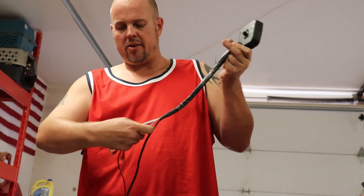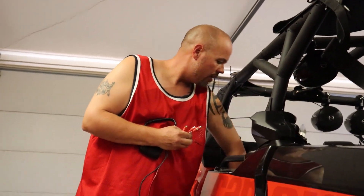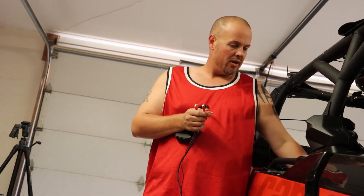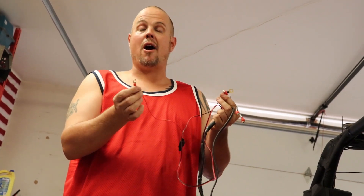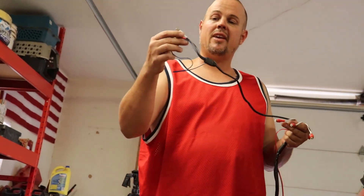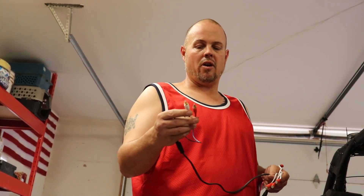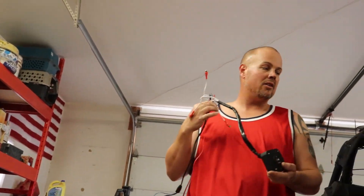You have four red wires that go to each one of your speaker wires — the red one plugs into the speaker like that. The yellow ones go to the harness that powers the LED lights on the speaker. Then there's the main cable that goes to your battery: ground into accessory power port on the block in the center console, and it has a fuse to protect it from shorts. There's also an extra cable for an external amplifier if you want to add one — that's your remote wire and audio RCA for the amp.